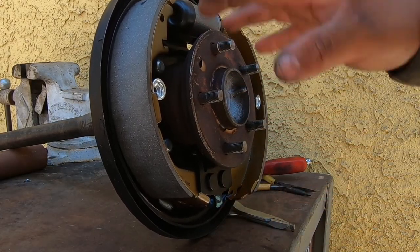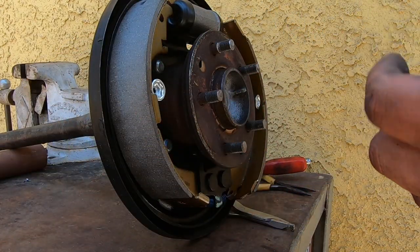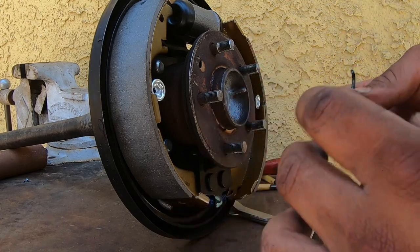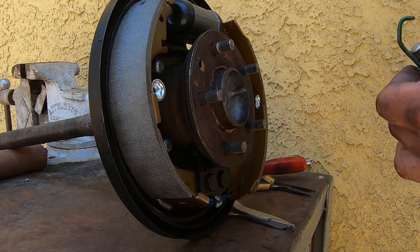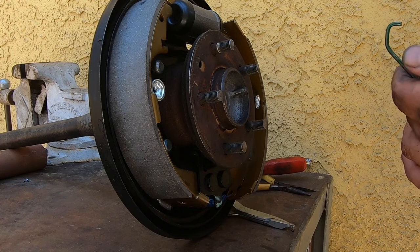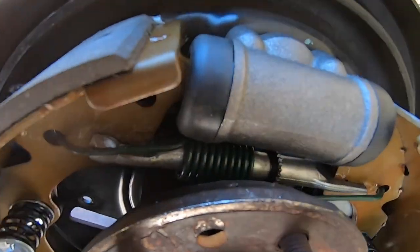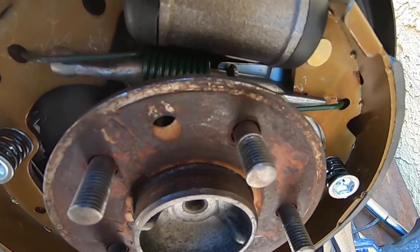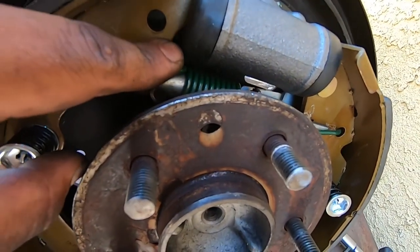Okay, now we got the front side of the shoe on. Next we have this spring — it was a hassle on the passenger side. Hopefully we'll get it right this time. We'll put a little bit of anti-seize on the threads just so they won't lock up when we have to adjust them. We're gonna drive it all the way in, most of the way in. Finally we were able to get this in. This is how the driver-side spring goes — the long side goes towards the rear of the truck, the short side goes to the front. Everything is assembled now; we can throw it on the truck.